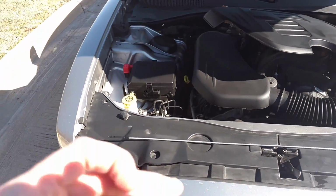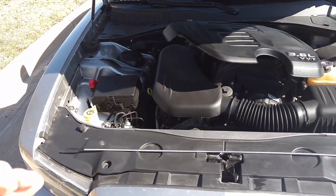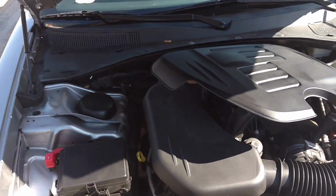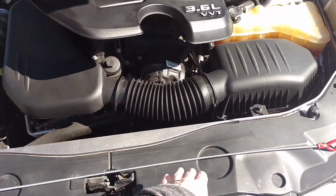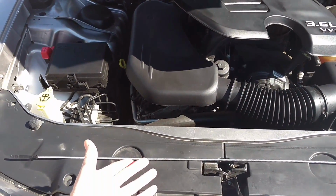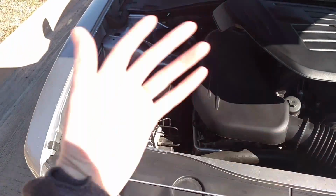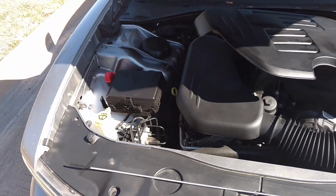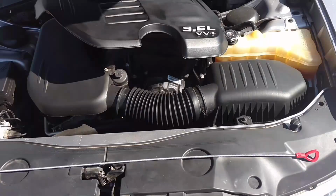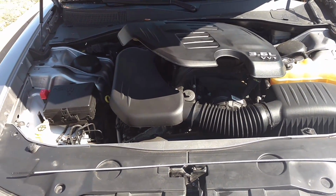There's an OEM tool that I found that's supposed to be the one the dealer uses, of course, but it also said that it sticks out a little bit when you go to check the temperature. So that's going to be the same result as this, as far as I'm concerned. The reason they do that is so you don't leave it in the tube and drive off with it not being a perfect seal, and get water down the tube, which is no good for the transmission. So I would say just go with this one. If you want to try the OEM one, that's probably a smarter option, but I feel like it's going to be the same as this pretty much.